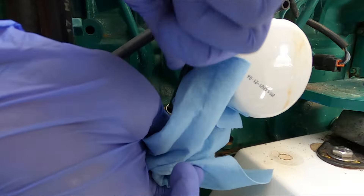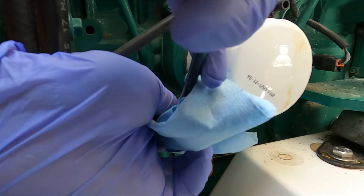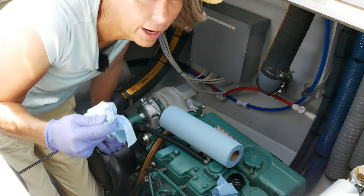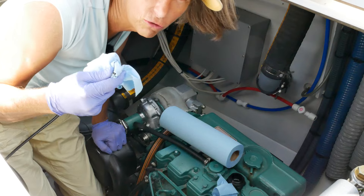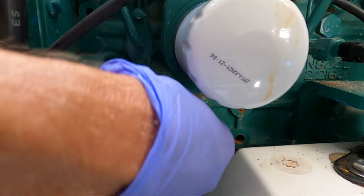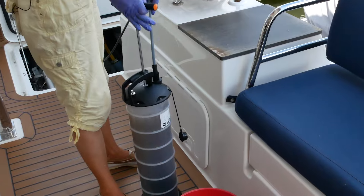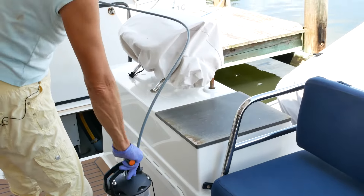I think that's about it — at this point we can pull our tube out. Be careful, there's a little bit of oil on the end and it's going to want to dribble. This is the point where you really get oil kind of everywhere, so hold the hose up and be careful. Since we're done, we can put our oil cap back on. A good way to evacuate the tubes is to hook it back up, set up a little vacuum, and pull as much oil back into the reservoir as possible.